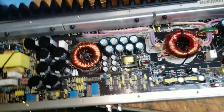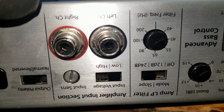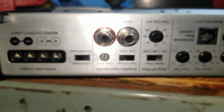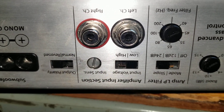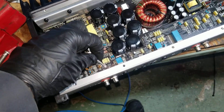That's pretty much it. These are great amps — it's just one little flaw. If you get something to round out that little metal contact and lift up on it from the other side, that will prevent your sound and bass from dropping out. Remove the amp, take off the back panel, get a little micro flathead and lift up on those little contacts — something small and strong.